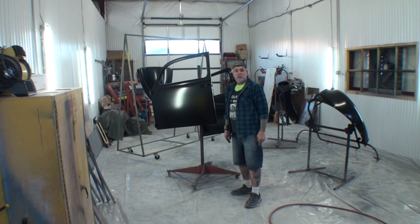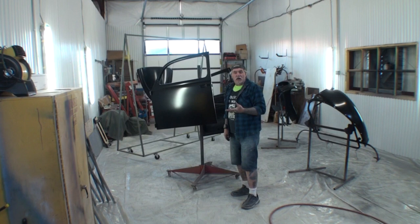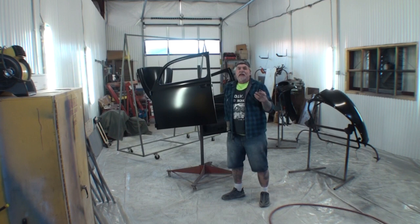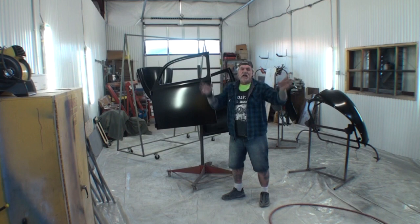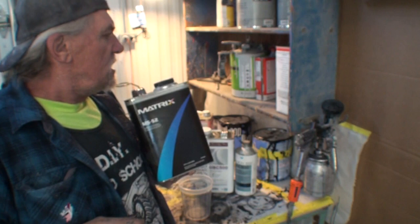That's what Color Blender Inner Coat Clear was specifically designed for: to put a coat of that clear on this panel so we can do our multi-color designs or artwork. So when you see these lowrider guys that do pattern painting and they got all these colors and all these designs, they're using that inner coat clear as a top coat to protect all the other paint that they put on there. Anyway, back to the situation.